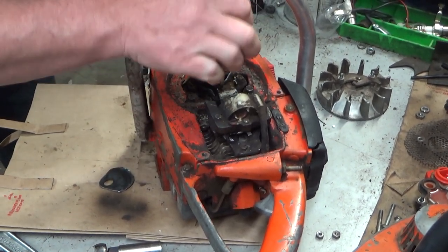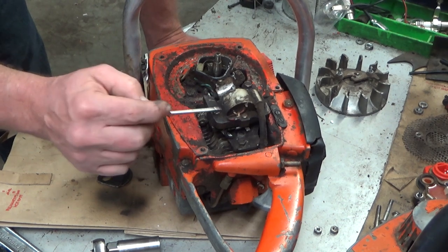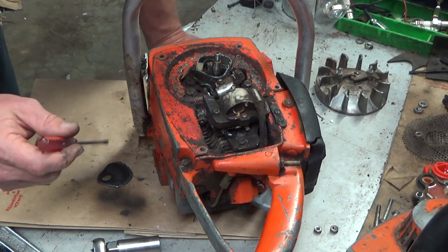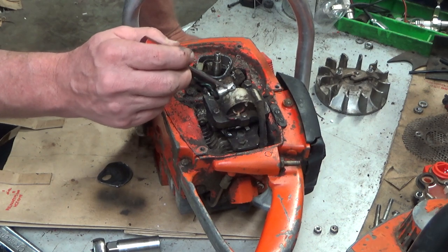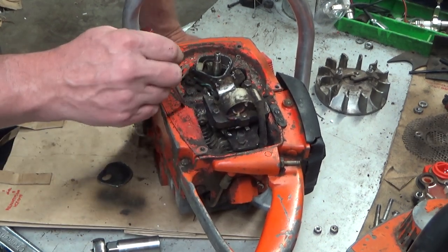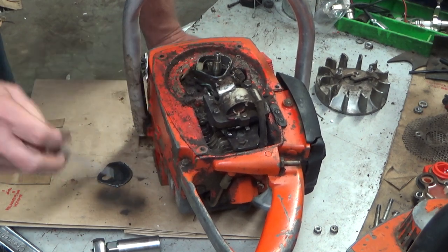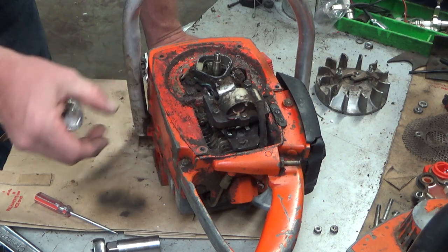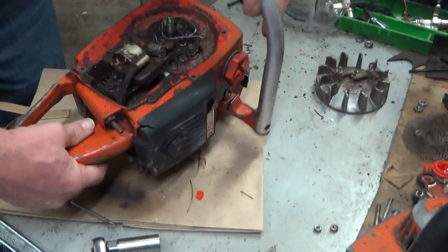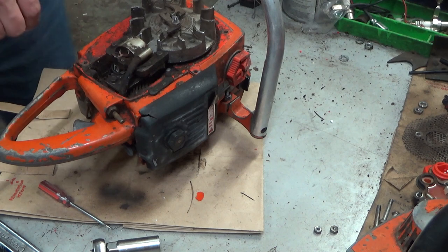Here's the bracket for the condenser — it's still tight but it ripped all the way around. And this coil being torn up concerns me. There may be some stuff I can salvage. If it still has spark, I could throw a new condenser on here and just use some epoxy to cover that up so water can't get in there. But this poor saw has definitely seen some things. It's got a pretty good heavy crust of crap on it, so this is gonna have to get all cleaned out. Either I'm gonna throw a complete ignition assembly on here or I'll piece something together. But that is good news because it's still way cheaper to deal with this than a seized engine.